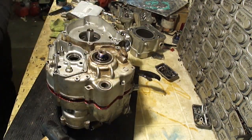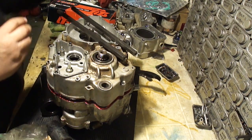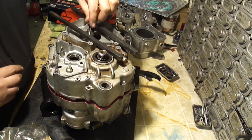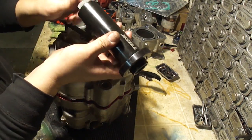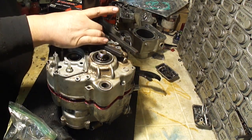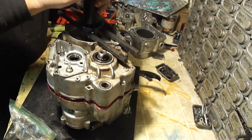Now I'm going to get the tool ready — the Tusk crank puller installer. It comes with a couple of parallels and some hardware. In this hardware we've got some bolts. I'm going to find one that threads into the crank. Then there's this cupped piece — you're going to put your bolt through there and screw that down onto the crank. Now you're going to take the puller, loosen the nut all the way back, and then thread this collar piece into the bottom of the tool. Thread it all the way until it stops. Put these two parallels in as close as they'll go, make sure they're flat and they're not sitting on nothing, then tighten this nut.